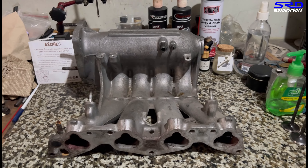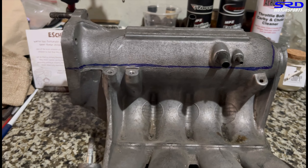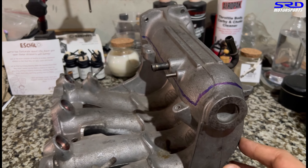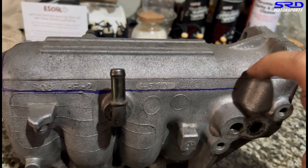Earl is going to upgrade to a B16 throttle. As you can see, the intake manifold is unported — it's fresh and stock. We've inked up the line here and we're going to cut it with a pneumatic air saw across here, through and through and then all the way to the throttle flange.